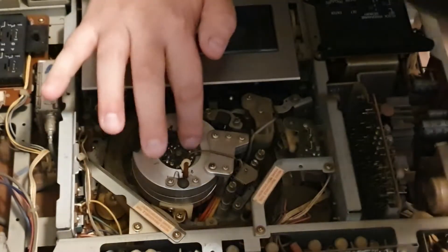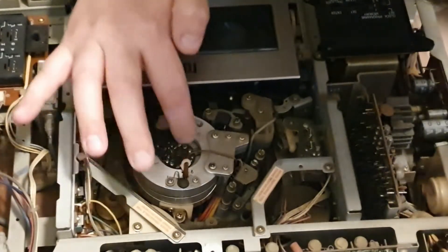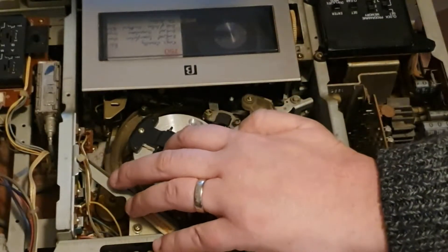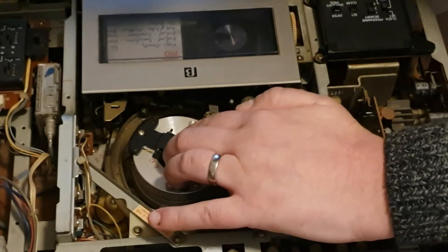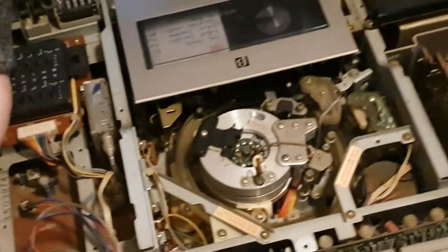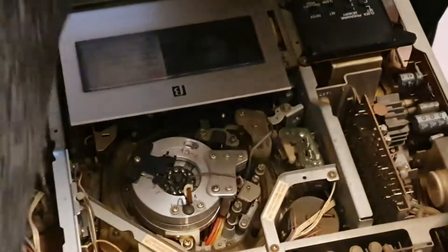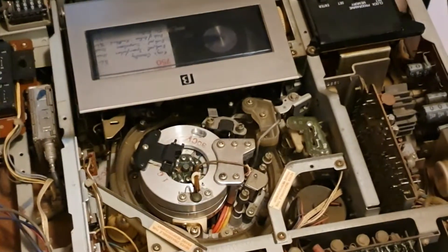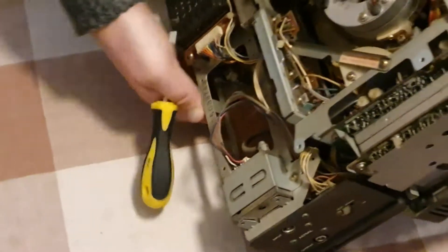I'm not sure if this is just a trait of this machine, but at the moment I don't seem to be able to rotate that head drum — it is really stiff. I wonder if I've got some problems underneath or if I have a failed motor, because I'm not sure what type of setup this has for rotating the head drum. So let's turn it over gently and get the base off.